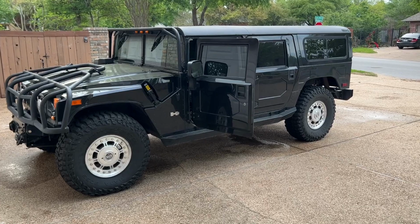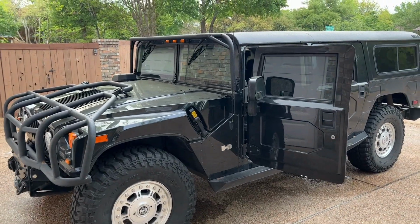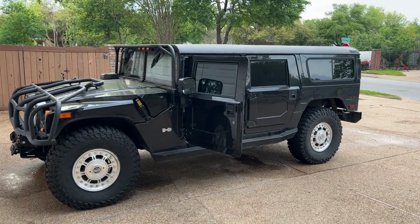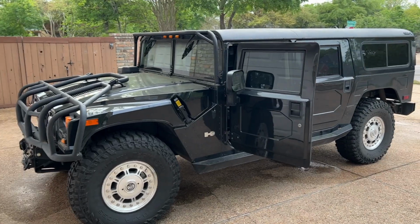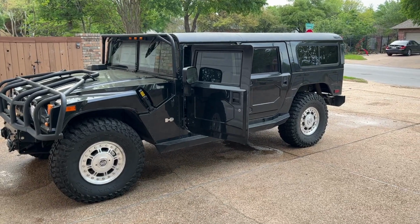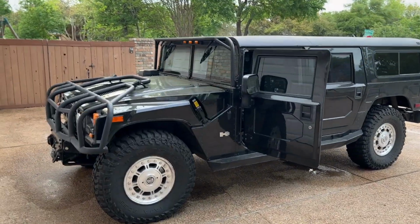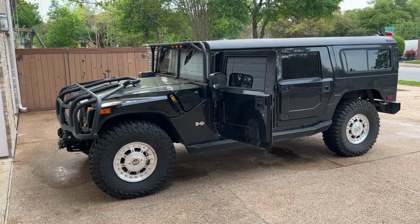He's running again. Can't wait to get that Raptor pump on and that Feed the Beast fuel hose upgrade. That way I will be 100% certain that the fuel system is flowing really well, way better than it was from the factory, and that no matter what sort of speed I'm going on the highway, whether it's 70, 75 or slower, I'm always going to have enough fuel delivery to the injection pump, and it's never going to be a concern again. Watch the next couple videos to see how that goes with the Raptor 100 pump installation. Hopefully it's not too bad.